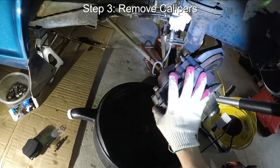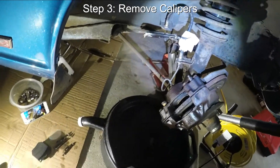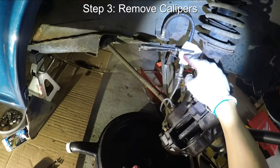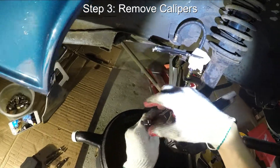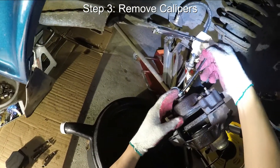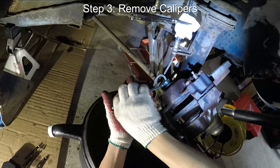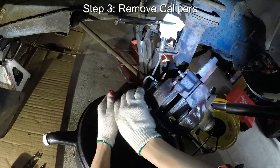So we're now going to try to remove this caliper off of the wheel assembly. What we're going to do is actually disconnect this brake line from the caliper so that we have an easier time removing it. You can see that I vise-gripped the rubber brake hose up here so that we don't lose any more brake fluid and introduce air bubbles into the system — well, any more than we have to. So we're going to take this flare nut wrench, 10mm, to loosen this. I really suggest using a flare nut wrench instead of a regular wrench because it is very easy to strip these bolts, and once you do that it's going to be a huge pain to get them off — you might actually need to get a new brake line.